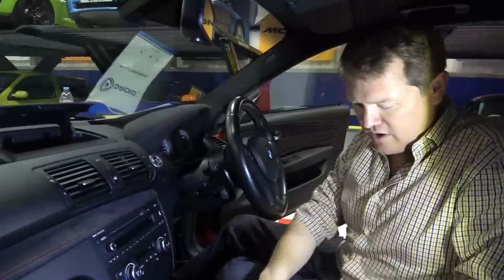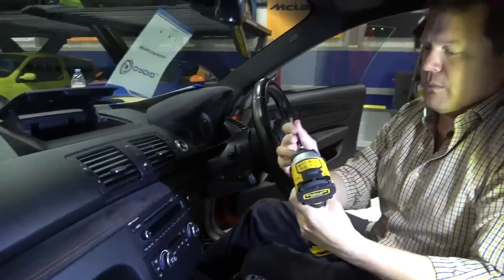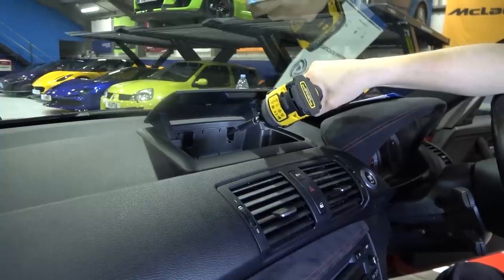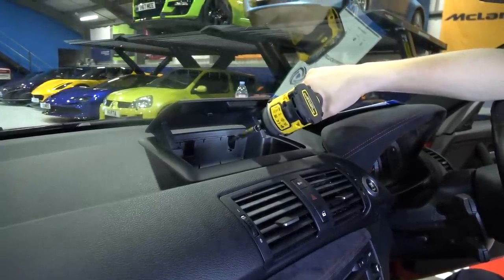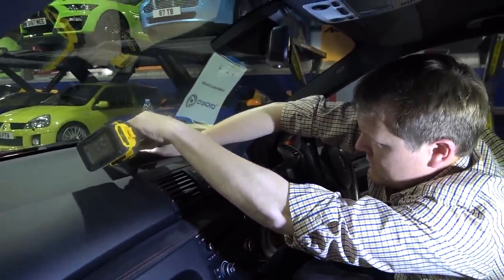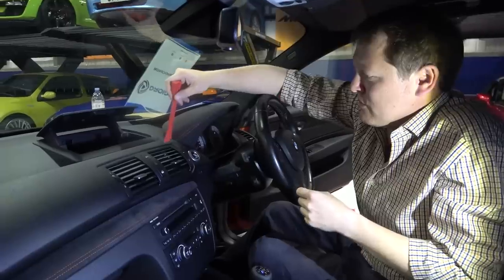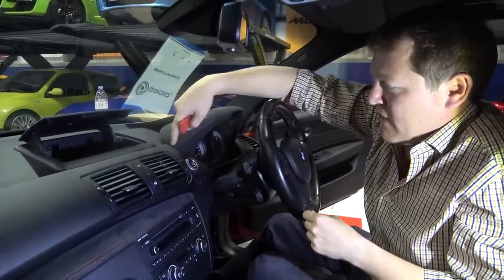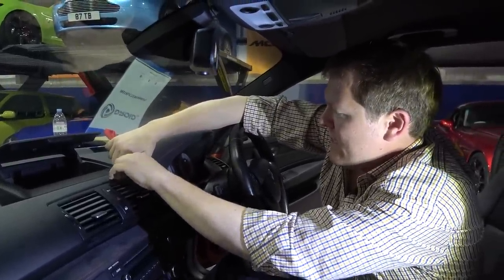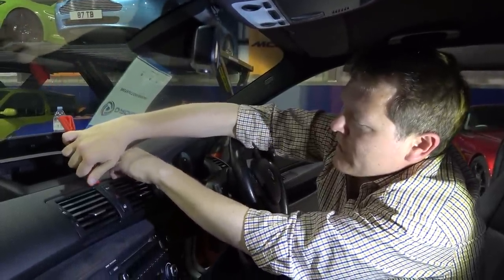It means pulling out that rubber trim inside and then using the extension — because it's slightly awkward and fiddly inside here — to just release the screws at the back. That's not going to be all to get this off but that is the start of it. Then this is the slightly more tricky part: using the trim tool to remove the air conditioning vents up top. There are four little clips here and it's a bit fiddly. It requires some force to basically get in there and pry it out, removing it from the top with the bottom following afterwards. Fingers crossed I can release this — I've heard some of the clips go.